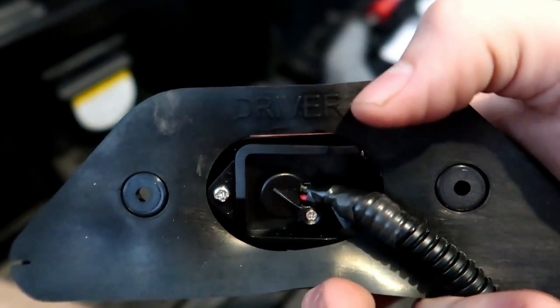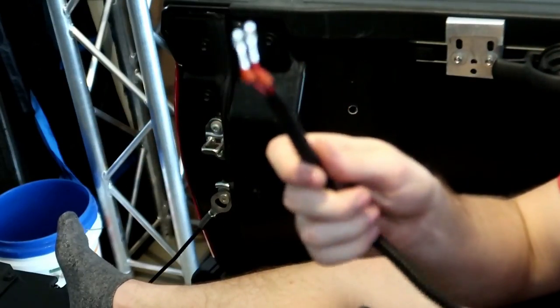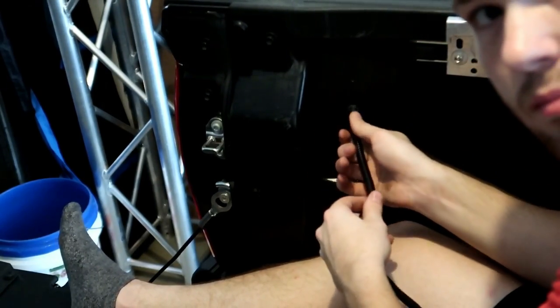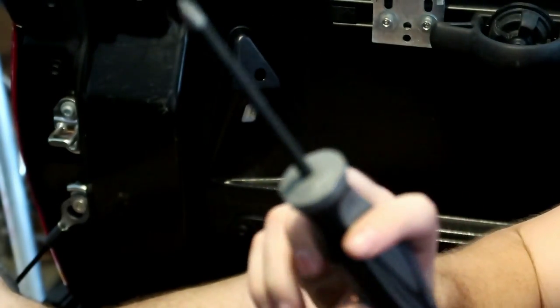Holes are drilled, so now we want to move on to actually mounting up our lights. Very simple — the four screws that I talked about earlier are what we're going to be using. You're going to want to use a screwdriver — not a drill. Like I said, fiberglass is soft, so as soon as you screw in with a drill it's going to keep screwing, basically round out the hole, and you're going to have to go get a bigger screw. On the rubber it's labeled 'driver' and the other says 'passenger.' First thing we're going to do is feed this wire through that 7/16th hole. Now we're going to take our screws, put them through, line them up with our holes, and screw them in with a Phillips head screwdriver.